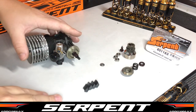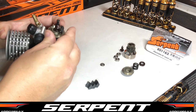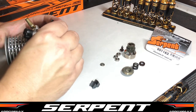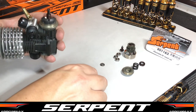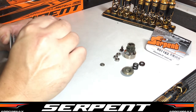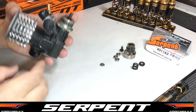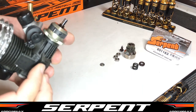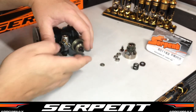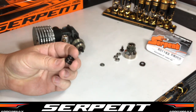So we've got all our shoes cut down nicely, now it's time to install. We also do an optional yellow shoe which is a softer material that gives you more bite. We tried that a few times and maybe in high grip conditions it could be okay, but the black shoe seems to work the best overall. So we just slot our shoes in, then the pressure plate — slide that over the top and that's why the shoes are locked into place.